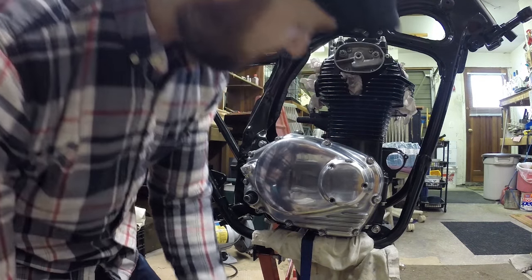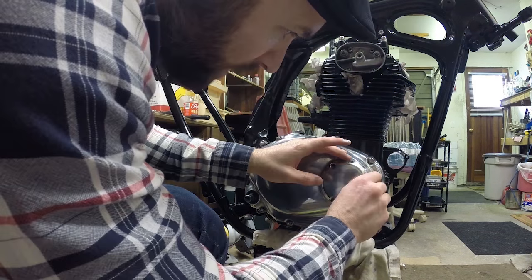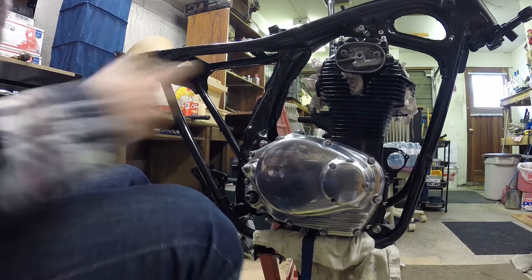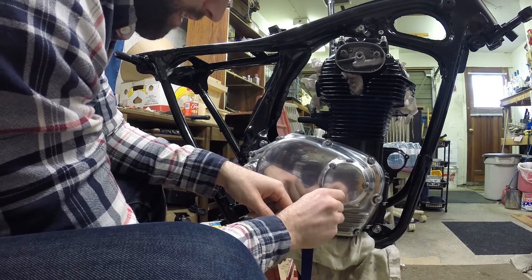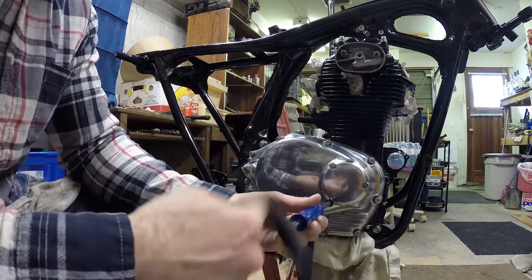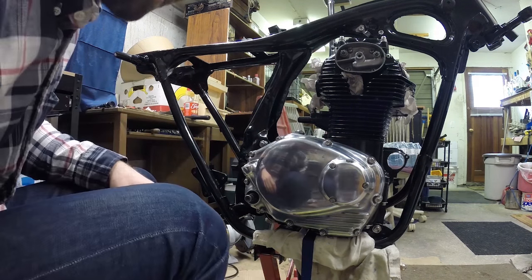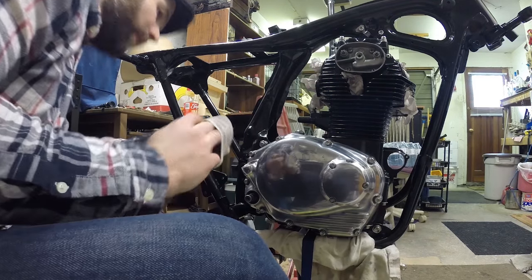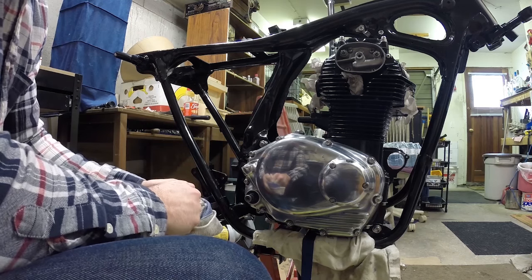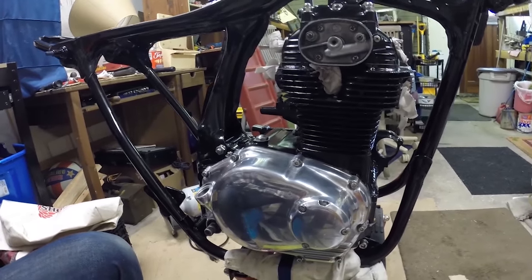There are three screws that go here, and they also come with the bolt kit. I put a little anti-seize on those threads. I'm going to have to take this off again anyway to bend the locking tab, so I'm just putting them in for now so I don't lose them. I'll leave them a bit loose to remind me to get in there and bend that locking tab back. Can't do the other side of the engine now because I'm waiting for some parts, but that'll get done eventually. That's looking pretty cool against the engine — I love the black and chrome look. It's starting to look like a bike.